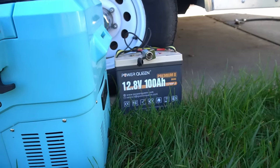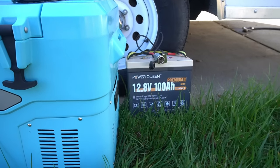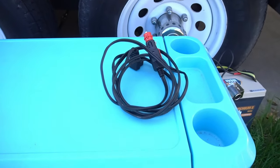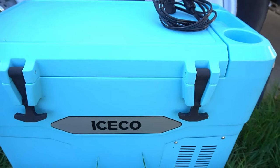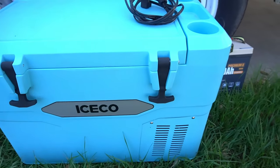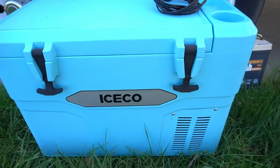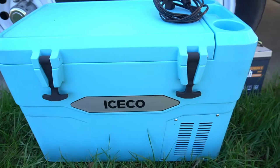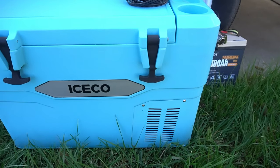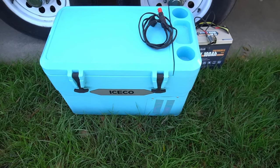I did have solar for the weekend, but after I hooked it up and let it sit for a day or so, I decided — let's see if this thing will make it on its own. It went 96 hours and it never failed. So it was Saturday night at six o'clock — there's the cigarette plug right there — Saturday night six o'clock till Wednesday around four o'clock is when I turned it off. So I'm going to hook this up to my battery charger, a 10-amp charger that will tell me how many amp hours it puts into the battery. This is not perfectly scientific, but we'll take the 100 amp hours, subtract what it charges, and see how many more days we could do it.